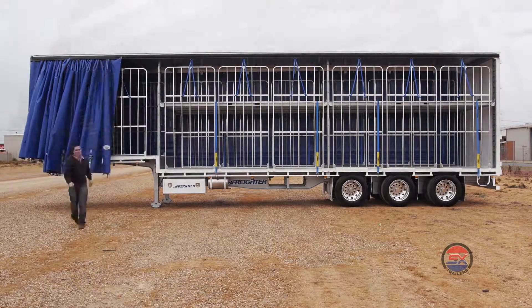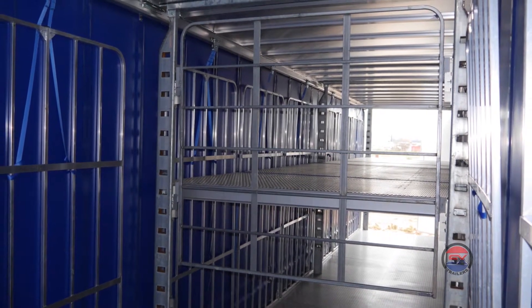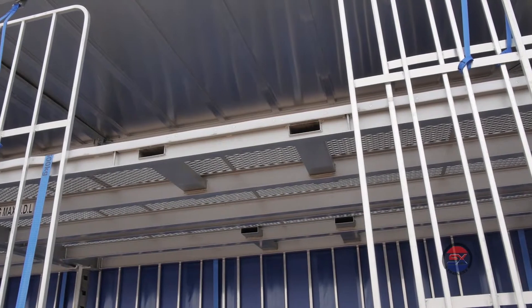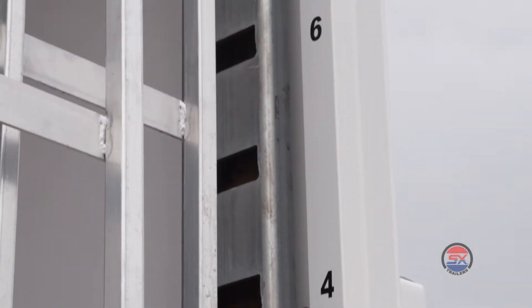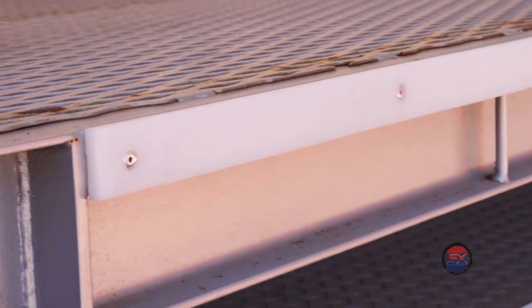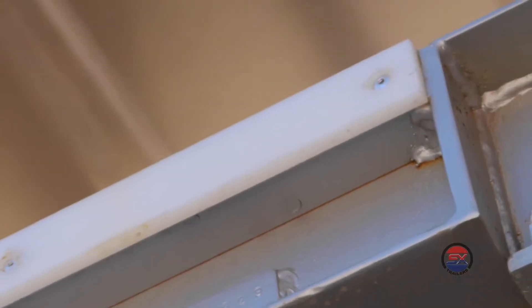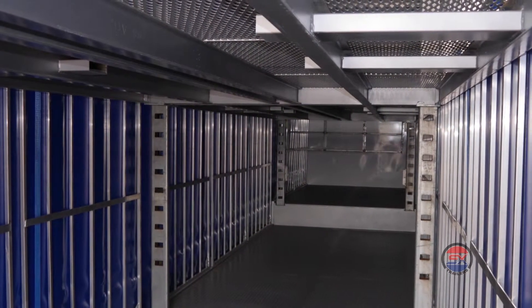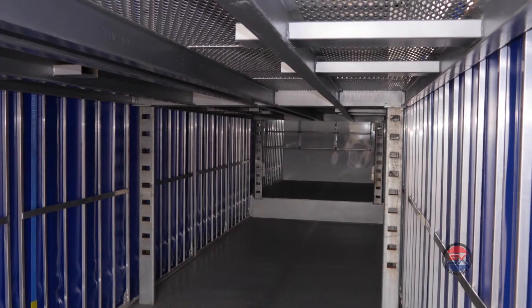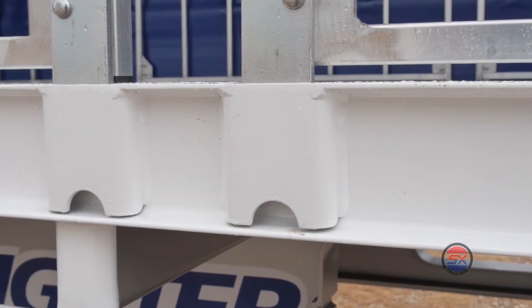These trailers are fitted with two mezzanine decks, with each deck rated to six tonne. Additionally, a five foot steel transverse gate located on the front deck prevents the load from shifting and potentially crushing the load below. Each deck is easily adjusted to the height you need using the forklift provision holes located each side of each deck, and the locations on the mezzanine posts are also numbered to make the height changing process quick and easy. This particular SX configuration comes with Pactene strips along the mezzanine decks to help protect the gates from excessive wear caused by metal rubbing against metal — a standard SX recommendation for all mezzanine deck trailers. If needed, the mezzanine decks and posts can also be removed so the trailer can be used as a conventional drop deck T-liner. The provisions include slide post keepers and extra combing pockets allowing the slide post to be simply installed.